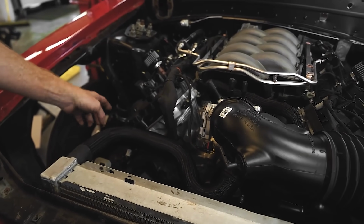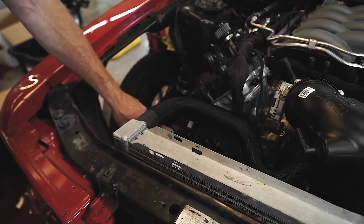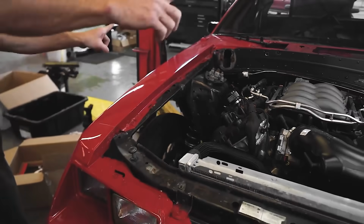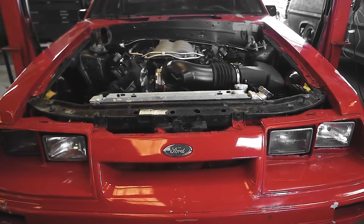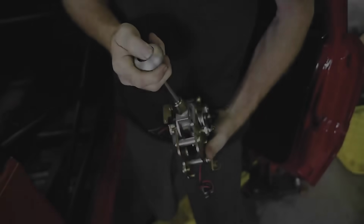I would use the CP fab, but I wouldn't use their up pipes. I make it come here, and I put the turbos here. Then you wouldn't have to move the computer. Then just dump the down pipes at an angle going out here. Teardrop it on each side, and that would be it. Two sensors in each header, and call it a day.